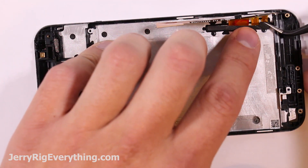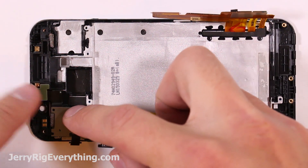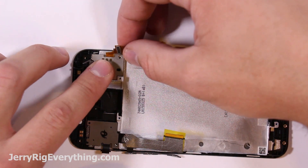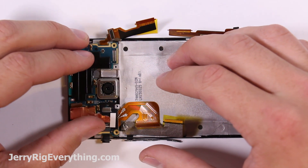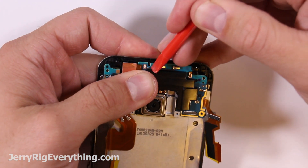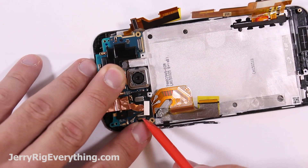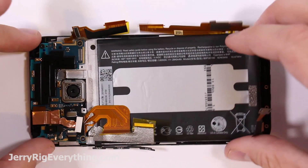Put whatever black piece that is back on the ribbon cable connectors. Set the SIM card slot back in place with the power button and volume buttons on that side. SD card is going back in place as well. Earpiece pressed back into its hole. Daughter board also getting pressed down in — you want to make sure that camera slips down inside of the little slot and gets latched down. Here are the two little pins on top of the motherboard, make sure those are pinched down. Camera gets pushed down in place with that little clasp. Now we have ribbon cables to put back together — the one above the SIM card tray — and four screws on the top to get screwed in. Slide the battery back into place.